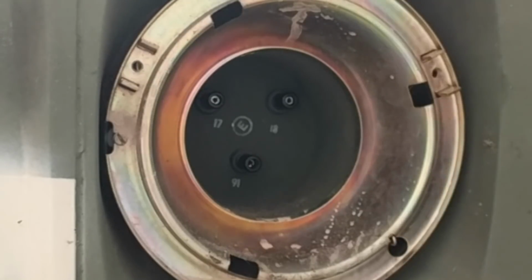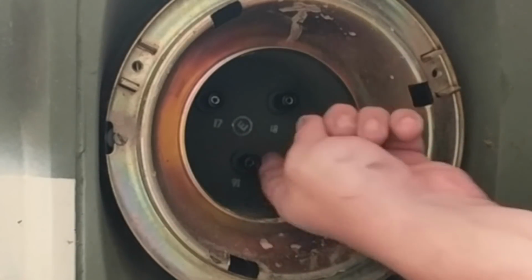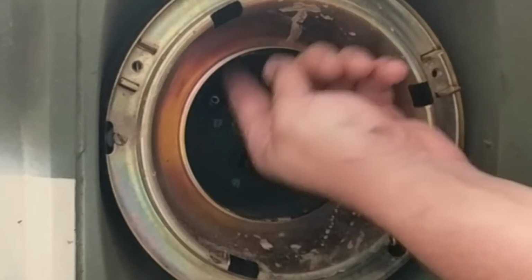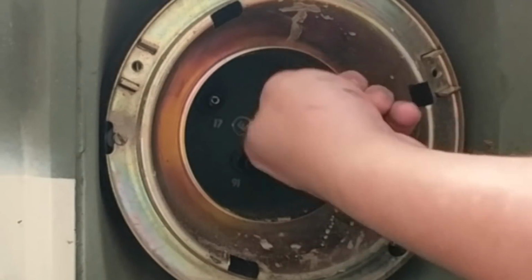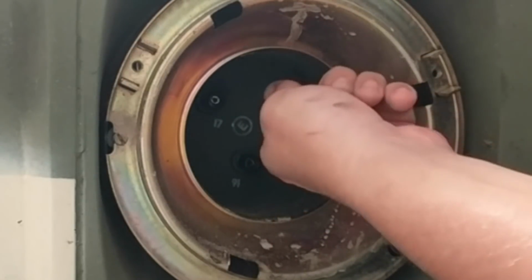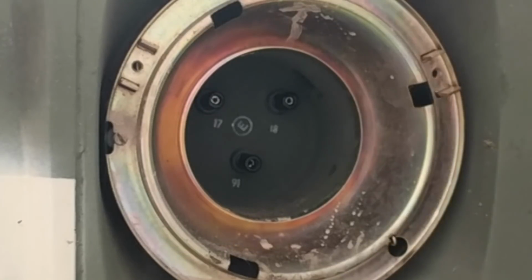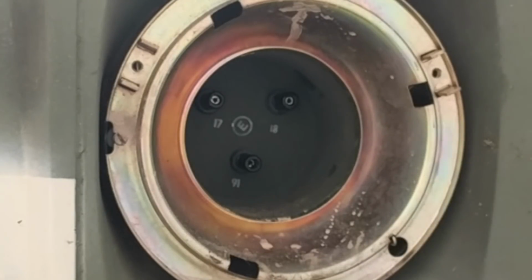Let's do the dielectric grease thing. A little bit on your finger, and all we're going to do is go around that rubber, that black part, with dielectric grease. This will help it disassemble easily next time, and you don't want to blob it like the people who do spark plugs and just throw dielectric grease right on the plug end. That works because you're not a high horsepower application, but that ain't how you're supposed to do it. You don't have to disagree with me about it. You can disagree with the head engineer at Holley about it. So I know he ain't wrong, and I'm just listening to what he says.